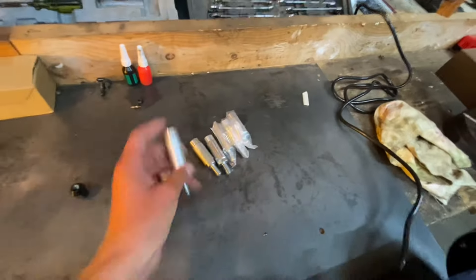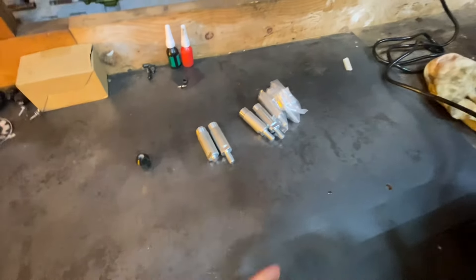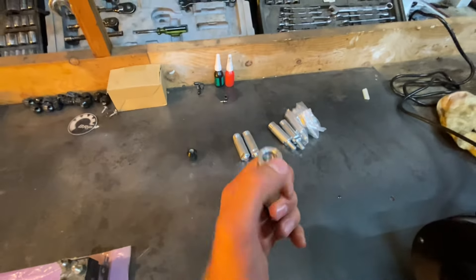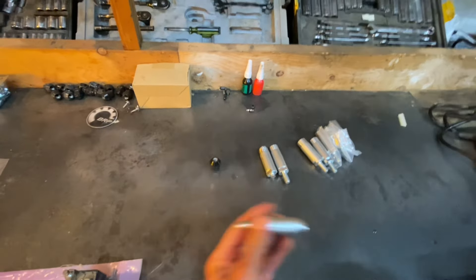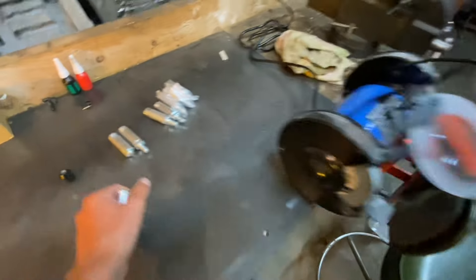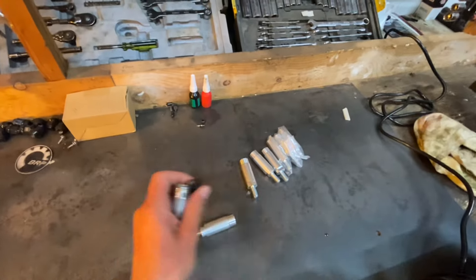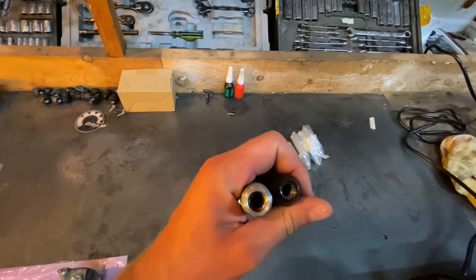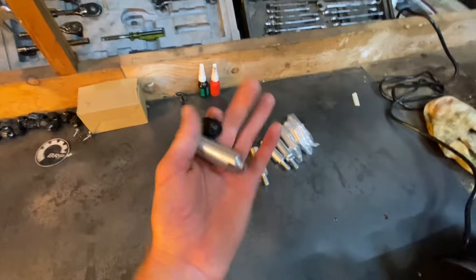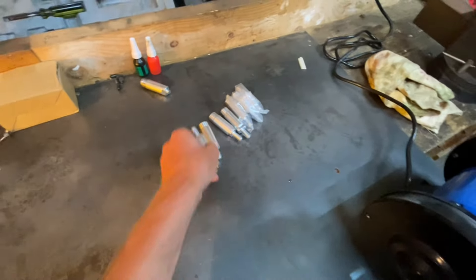When you buy them, you can get a set of — they came with 16 and I think it was like $65. So they're super cheap. If they don't work, I'm not out a whole lot. And they look like this — you're supposed to take your tire off, thread this on, and then put your tire back on. What I had to do was take it to the grinder here and grind them into the shape of the nut, because you've got to hold your tire on. So I've got lots of spares and then you can just thread them on and start stacking your spacers on.